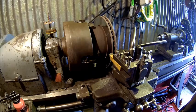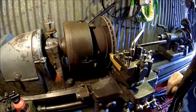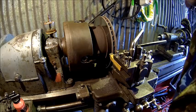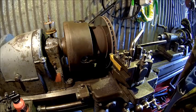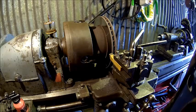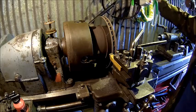We're right at the edge of what the machine can do. I had to angle the top slide a little bit outwards to get enough stick-out on the tool here. Hopefully that's going to work. Everything is on maximum. The problem is the disc is actually hitting the cross slide. I'm not entirely sure if this works. I expect some chatter because we're playing with the limits of the machine here. Let's see how it is.